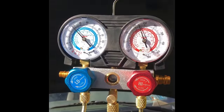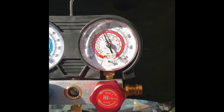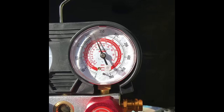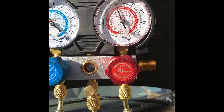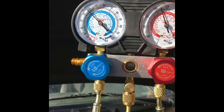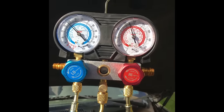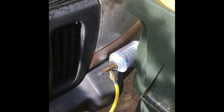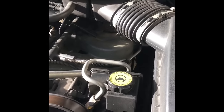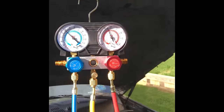To wrap it up — final product: we have our low side at about 40 pounds and the high side is a little over 200. Based on the ambient temperature outside, there's a range of 30 to 50 pounds on the low side — it's not too humid today, so 40 is about right. I just felt the vents on the inside — that air is cold as can be. There's a little bit left in the can and I shut it off at about 24 ounces. Look at that AC compressor just turning and burning.